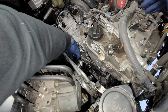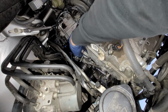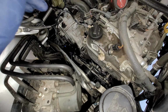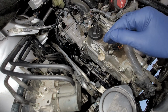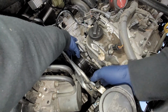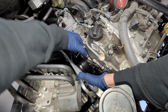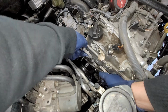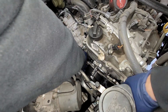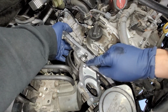All right, so I want to say we'll take out the pulley with it. How can we do this? The blade broke. This is part of the water pump. Actually, I can see more fan blades inside the system. All right, so let's see. Should slide right out. It has no fan blades. Huh, that's weird. So let's see if we can pull this back, and then we'll swing it right over, I think. No? Maybe so. Oh, there we go. Yep, all the fan blades are gone.